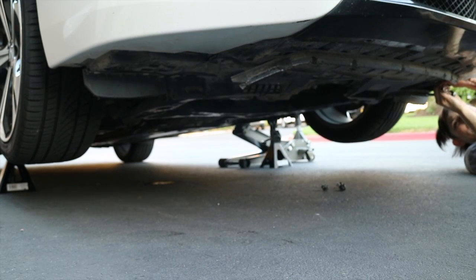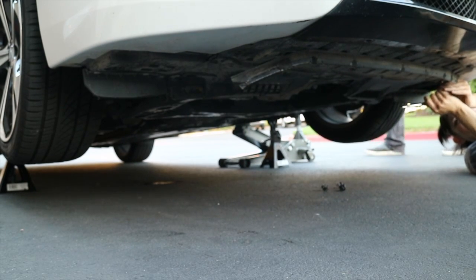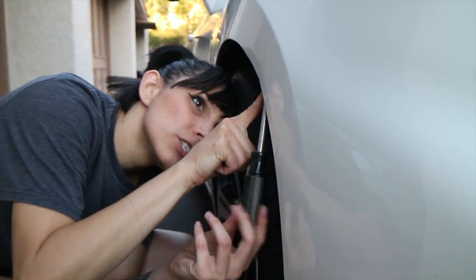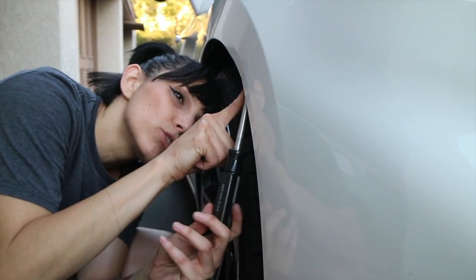Toolbox. Yeah, we're doing our front splitter. I like that. It's nice. Oh, thanks. We took off the clips on the bottom and we unbolted the two bolts that I showed you with the 10 mil. Now all that's left is getting into the wheel well. We're gonna take the two screws out and I'm gonna have Rob film me while I do that, just so you guys can see it. It's funny because this one video is from ProCivic.com and he's like, yeah, you just gotta sit here and struggle with it and keep struggling with it.